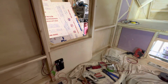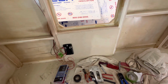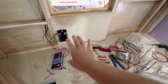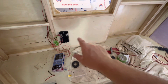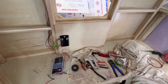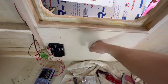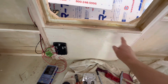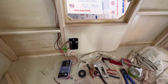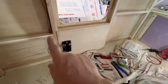And then I've started some of the electrical here. So there will be a countertop here and cabinet space below here. And the solar gen will sit in this area. So this is a natural location for the fuse box and the terminus of all the wires for the various things in here. There's insulation I put in there, and then I just cut out this piece of 1/4 inch ply here to function as a nice mounting location for the fuse box,